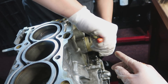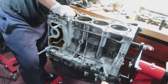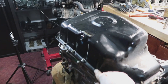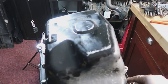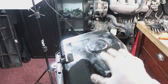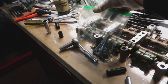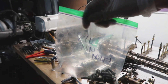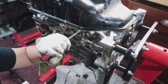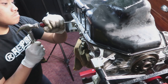We're going to go ahead and take off the oil filter with the tool that Andrel just had. We're going to flip it around and take off the oil pan — now we're exposing the oil pan. We're going to get all of the bolts off the oil pan. When you put the oil pan on there is a sequence, but right now we're just taking it off. Andrel is just getting a hammer to a flathead and prying that thing open — it's pretty tight. These are 14s right here.